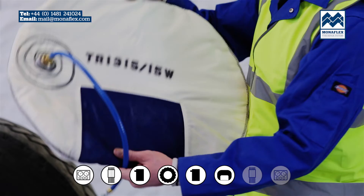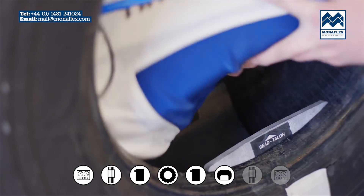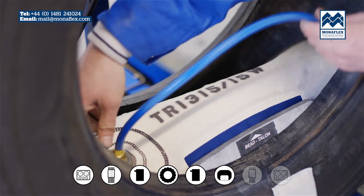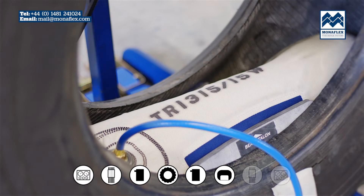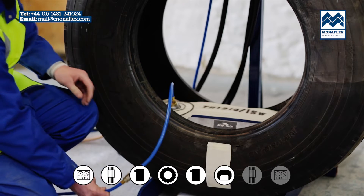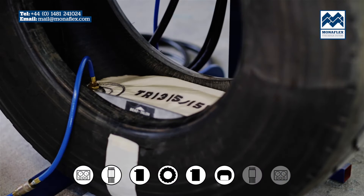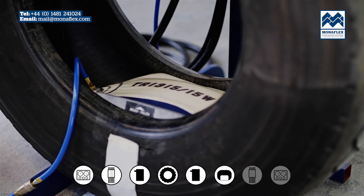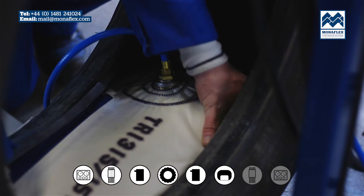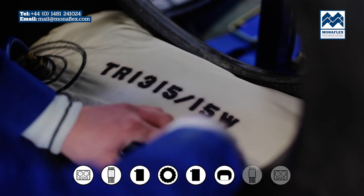Take the cylinder air bag, tuck in the ends of the bag and fold lengthways along the valve line. Place the cylinder air bag centrally behind the inside heat pad. The blue elasticated window should be positioned facing the sidewall on the repair side. Connect the blue air line to the cylinder air bag hose. Switch the incoming air tap to ON and partially inflate the cylinder bag by pulling down the slide valve connected to the blue air line. When the cylinder air bag is taking shape, stop the air supply and check the positioning of the bag. The annotated name of the cylinder air bag should be visible on the cover between the beads.